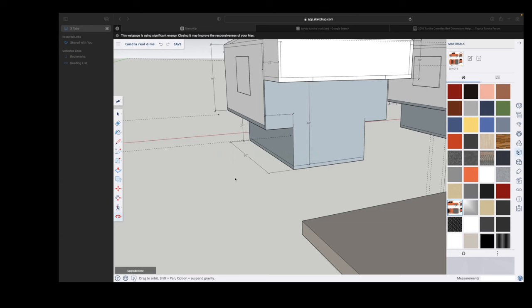So the dimensions I chose for the truck camper are going to be 48 inches across the bottom. So this will fit perfectly between the wheel wells, which is a little over 49 inches. The sides of the tub extend up 24 inches, which is just a little higher than the side walls of the truck bed. And then the wings come out about 16 inches on either side of it.